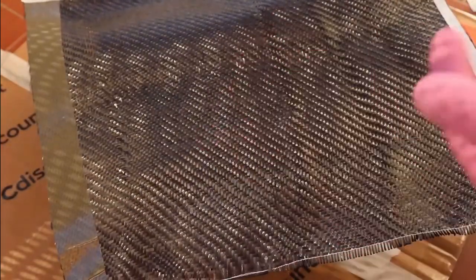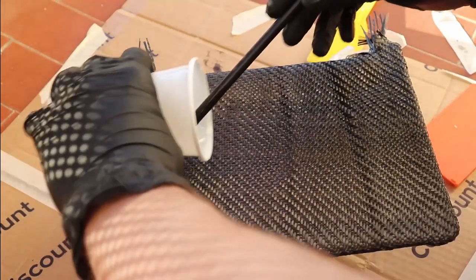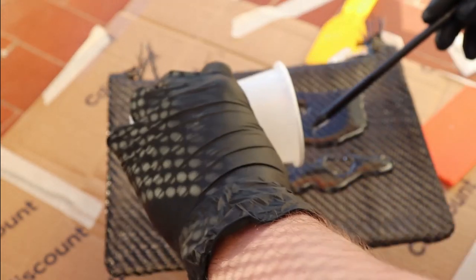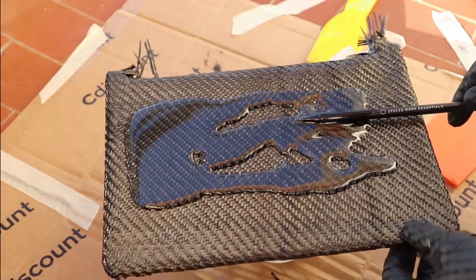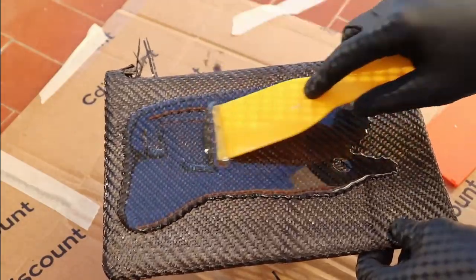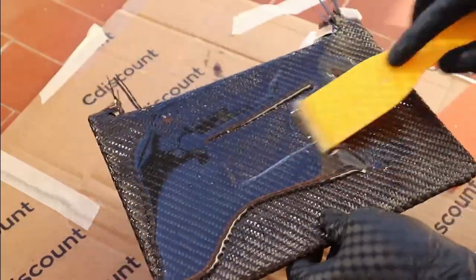What I didn't realize is this is quite a complex shape to skin for a beginner. At the bottom of the lid I had problems with the material not sticking down and lifting up due to the bend radius. When I do this next time, I will not stick it underneath for such steep angles. Now I'm mixing another batch of way too much resin and I will completely soak the carbon fiber.